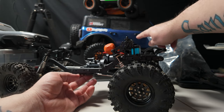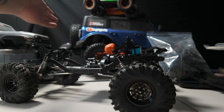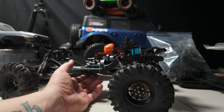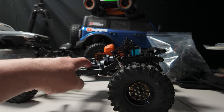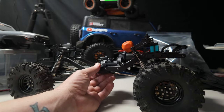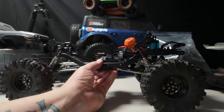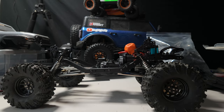I've just done the 6-month review of the Bronx. I'm actually a fan of that. I think for the money, this thing has done very well. Although we have changed a few bits out, you could have run it standard for a trail truck and you would have had a great time with that. But not so much with the Gladius. We've had reliability issues, you know, the gearing, front and rear locking differential mechanism not being great. Now it's locked out. Obviously, I don't have the ability to unlock and lock the diffs now, but it's really nice now. I don't like the gearbox, it feels a bit cheap and nasty. So we might put an aftermarket, maybe a Vitavon case in there, or a genuine sports transmission, as I said earlier.